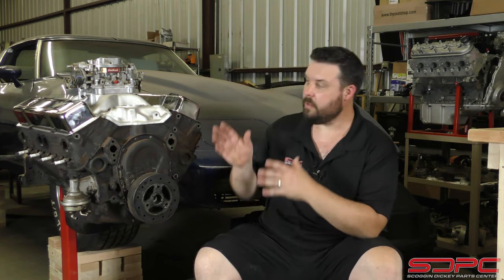On production Vortec engines — we are talking about the '96 half-ton 5.7 liter engine, the cylinder heads everybody talked about for years — those are the ones where they actually went away from this internal bypass, and I am talking about production engines specifically. So if you grabbed a '96 or newer half-ton truck or a 5.7 350 out of a van and you're looking to hot rod it or swap it into an old vehicle, you need to know this information. If you don't do what I'm about to tell you properly, you can actually overheat one of these engines very, very quickly. We have had a handful of customers who unfortunately learned the hard way. They spent all the money to either rebuild what they had or bought a stock replacement from us, then threw on an Edelbrock intake and a Holley carburetor, got it all fired up, and just in a couple minutes idling it already started to overheat. Unfortunately we've had some customers that lost their pocketbook on this one. So please listen along as we try to explain what's going on here.